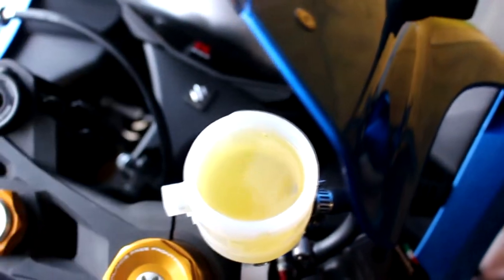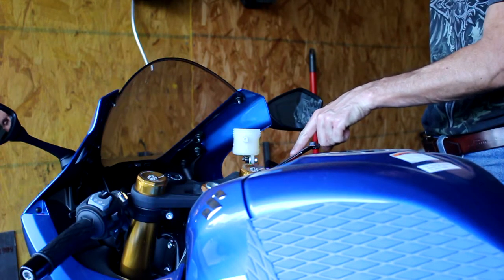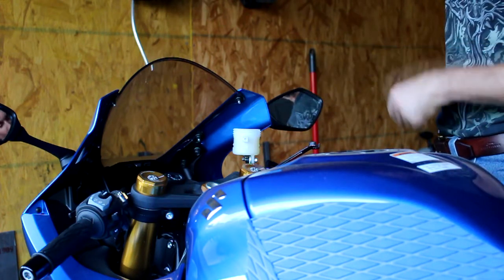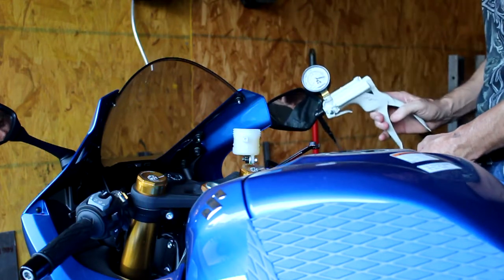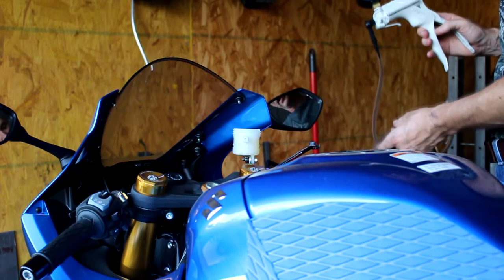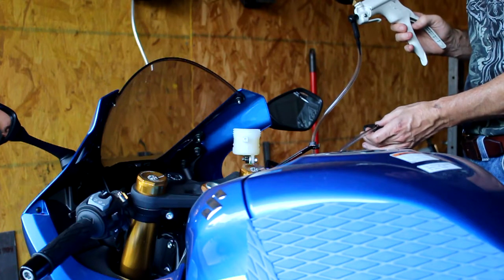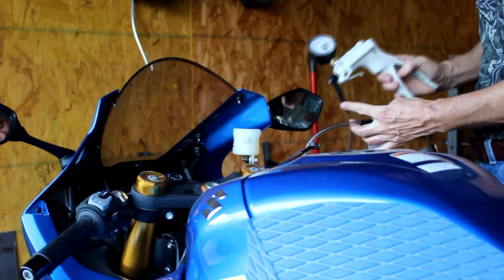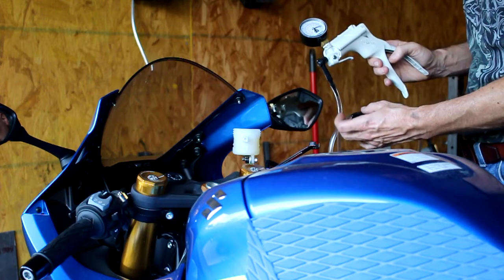I'm filling it up a bit more — okay, that's pretty good for now. I've got a wrench on the master cylinder bleeder screw at the top, a pretty full amount of fluid in the brake reservoir, and my MightyVac in hand — you can see it's at zero. I'm just going to let the container hang. I adapted some hoses from another kit to get more length, and I made sure all connections are really, really tight. You can even put hose clamps on there if you want to be sure.